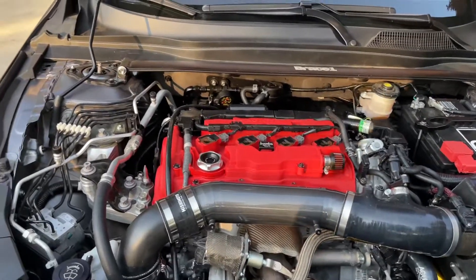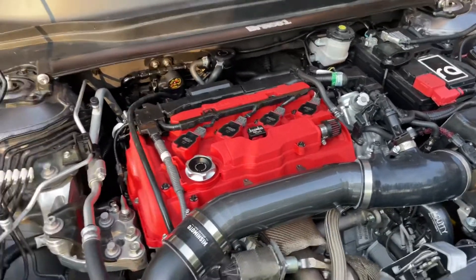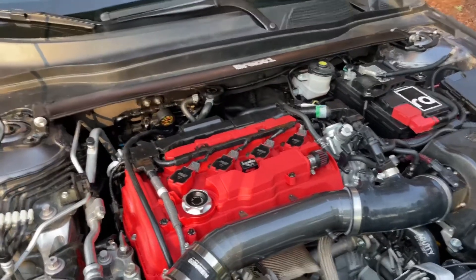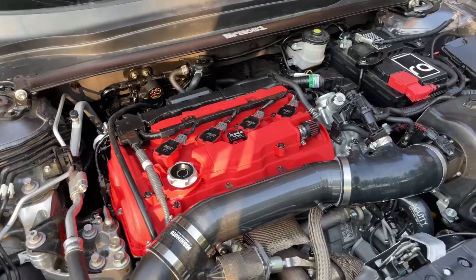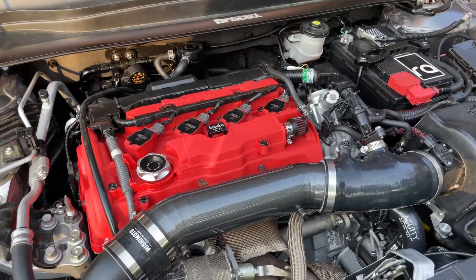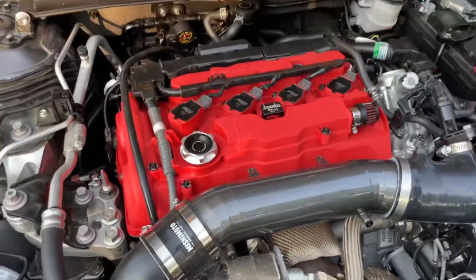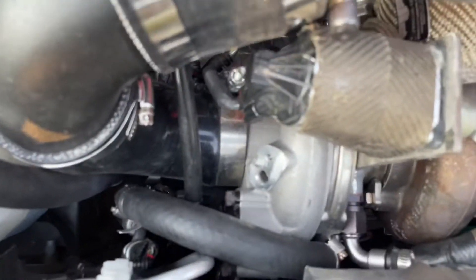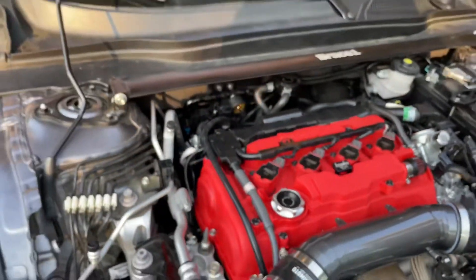The port injection is working just fine. I'm able to hold about 31 PSI of boost — perfect. We ran into issues with it not holding after shifting from fourth to fifth gear; it would just slowly decrease and never recover. It wasn't a boost leak — I replaced all my vacuum lines and made sure everything was tight. So I'm thinking the bypass valve diaphragm may have gone bad. I'm going to test that to see if it works. If it doesn't, my next step would be to replace the wastegate actuator, which I'm hoping isn't the issue, but either way they're both fairly inexpensive fixes.